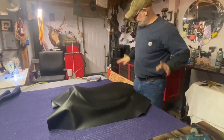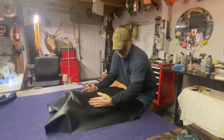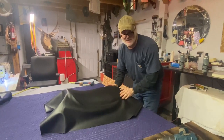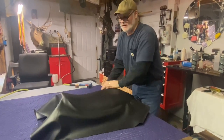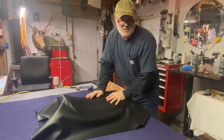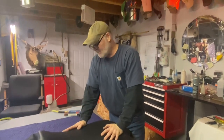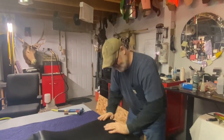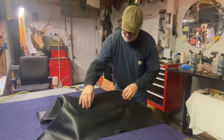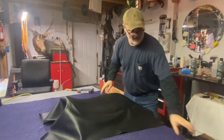So now at this stage we have our field done, and our outside edges — we have our roundness across the back. Most of these seats are always tapered in the front and they crest up. Whether it's a snowmobile seat or an ATV seat, three-wheeler, four-wheeler, they all crest up and they all have that rump on them. So you start in the field and you leave the glue — don't glue all the way around the edges. So now you have your heat gun.